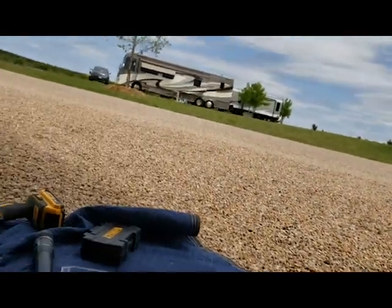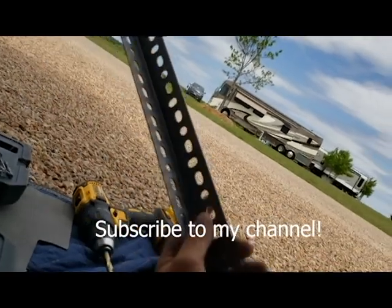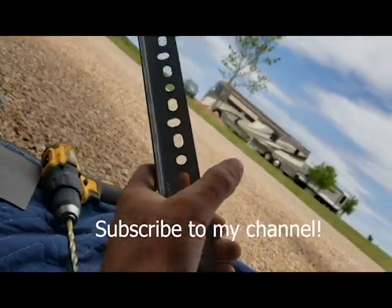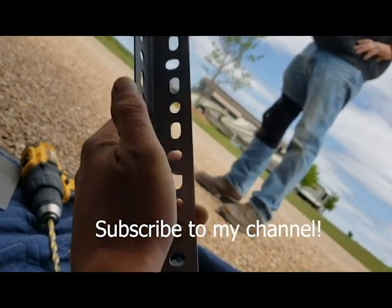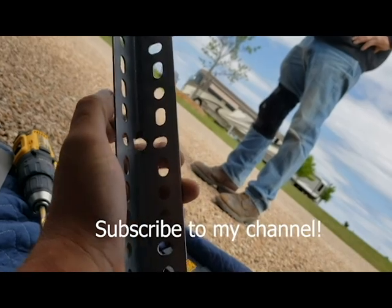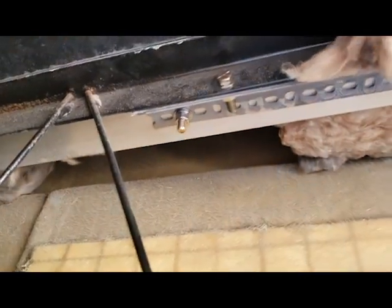Let me show you the material. We don't have the exact piece we used here — this one is for a spare tire repair — but anyway, it's a piece of angle like this, except that end is about two and a half or three inches on one side, and an inch and a half on this side of the flange. We're talking about that area right there. Here's your spare tire area, there's the back, and there's the repair. He did a really good job. They are not going to have any more butt wiggle there.